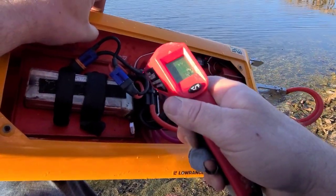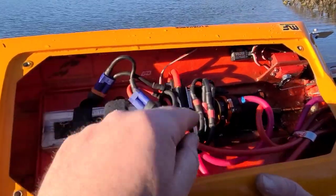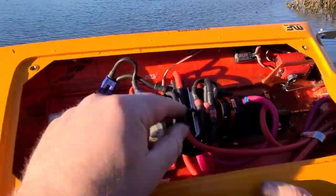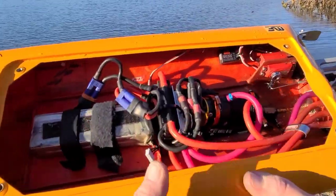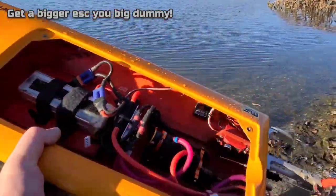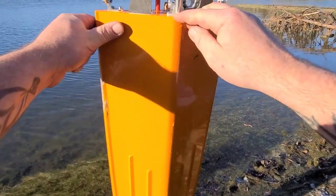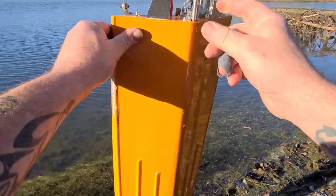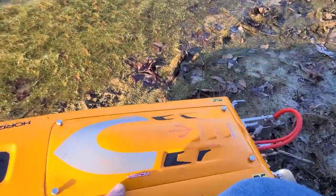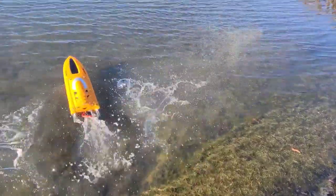78 on one reading, hit 96 somewhere else, 77 on the motor back-end bell. That's cool - nice and cool. With this 150 Fly Color on 6S it starts to get hot, but with a 4S pack it's perfect for this boat. I'm glad to see there's no water in the boat - not even a drop. That little silicone tube did the trick.